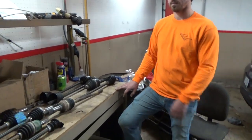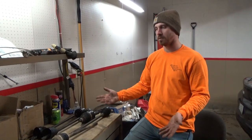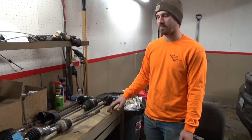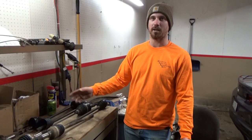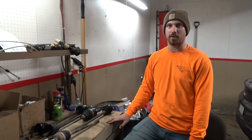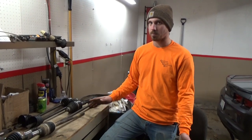For our kind of riding, I wouldn't recommend going with any other axle as a spare or replacement. We're running 30s - maybe if you're running 32s or bigger you'd need a stronger axle. I've done a lot of research on this and I haven't really seen anybody have luck with anything else. I've seen people try different things and say the shaft is bigger and stronger, but it truly isn't.